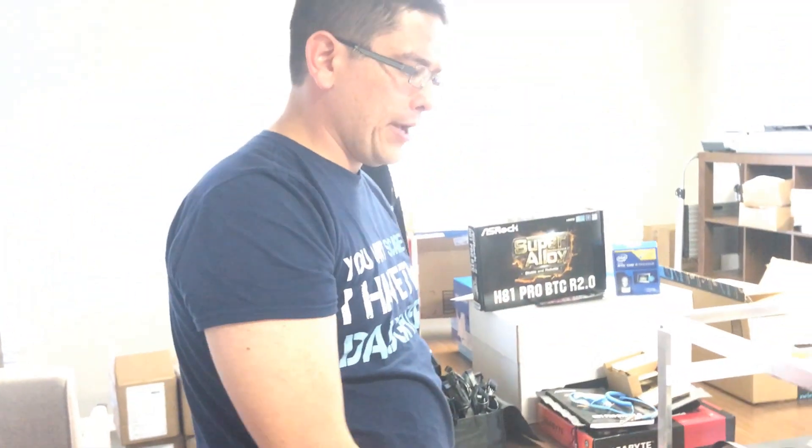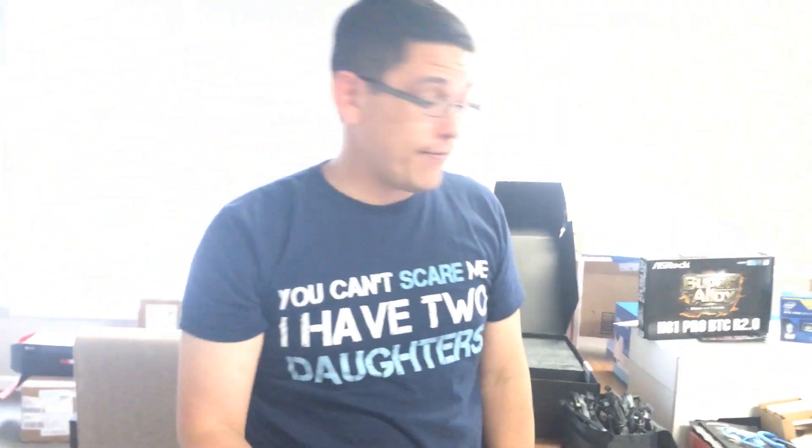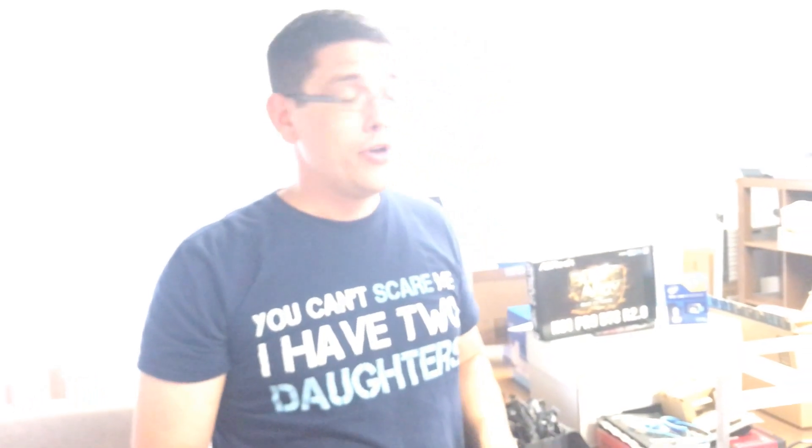A couple of issues came up during the test runs. The power switch was placed in the wrong spot — it needs to go on the correct pin header, which is 3 pins over from your SATA connector on the motherboard. That's actually a mistake that was even in the manual. The other thing I forgot was to plug in the power cable to the motherboard. You need both the main ATX power and the ATX CPU connector plugged in — I only had one of them connected.